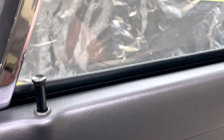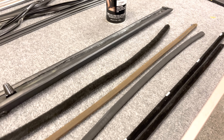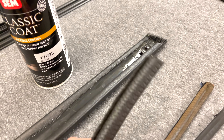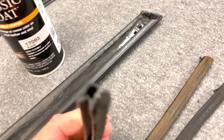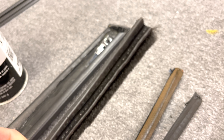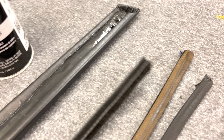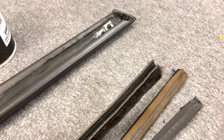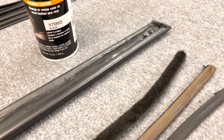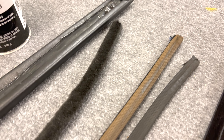Let's put a clip in here and I'll show you exactly what I did to resolve it. So let's explain what's going on here with our inner and outer door felts and see what the problem is with our garnish rail and why I can't get the passenger side to work. This is the felt I was trying to press in there, and this is the new replacement that Porsche supplies. It's spec'd out for a few different models, so it's kind of a general fitment. But on this early garnish rail, it doesn't really work that well. We did get away with it on the driver's side door, but there's just enough difference between the driver's side and passenger side — we can't use that. It's just too much buildup; things are hitting and rubbing and I can't get it pressed in.